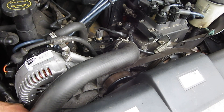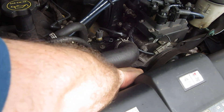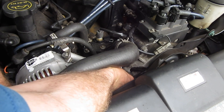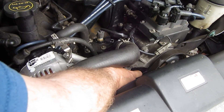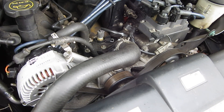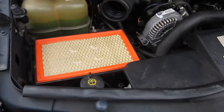Here I'm going to pull down on the tensioner arm. Let's see if I can tuck this belt under here while keeping all the belts on the pulleys. Put that on that pulley — what a pain. I think it's almost there though. I'm going to have to ratchet it one more time and then bring it down. Looks like I got it around that pulley — it's around all these pulleys over here and I think we're good to go. I'm going to put the air filter back on because I had to take that off, and then we'll test it and see how it works.